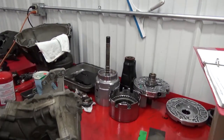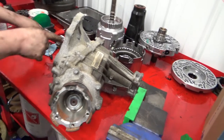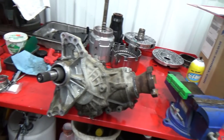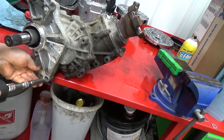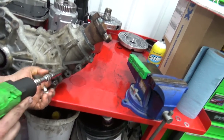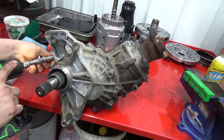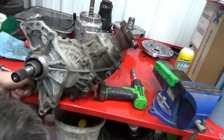Alright, now we're going to get inside of it — never done this before. Always replace this seal. As you can see, it's pretty flat. That's the one that keeps fluid inside the transmission. Now we're going inside — we're just going to go with a bunch of 10mm bolts all the way around. I'm hoping we don't have to take that out, but I don't think so based on the component view. There should be all of them.